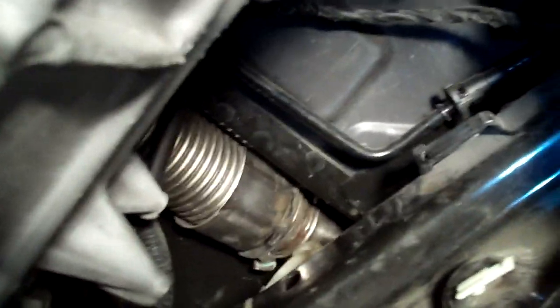And then next thing you do, up in there's a bracket, and you just pull this out of it. It's not clipped in or whatever per se. Well, it's kind of clipped in. It's just a little C. I mean, it just pulls right out of it. You don't have to unbuckle anything. And then up over the top, you see that white line. You got to push the button down on that and then gently twist it and pull it off for the evap. So I've got the crossover pipe out and off.